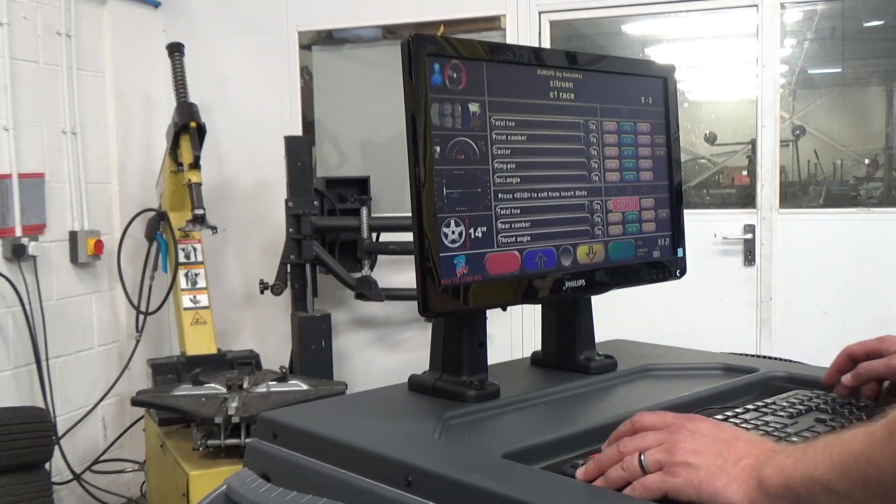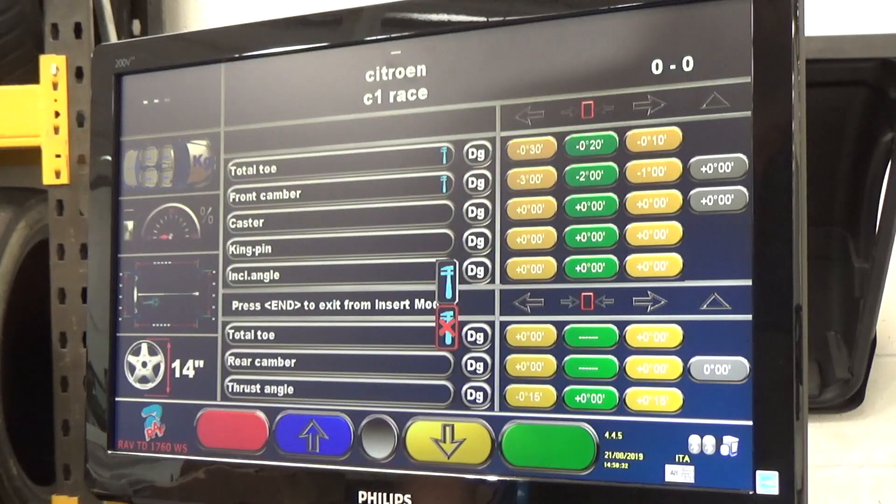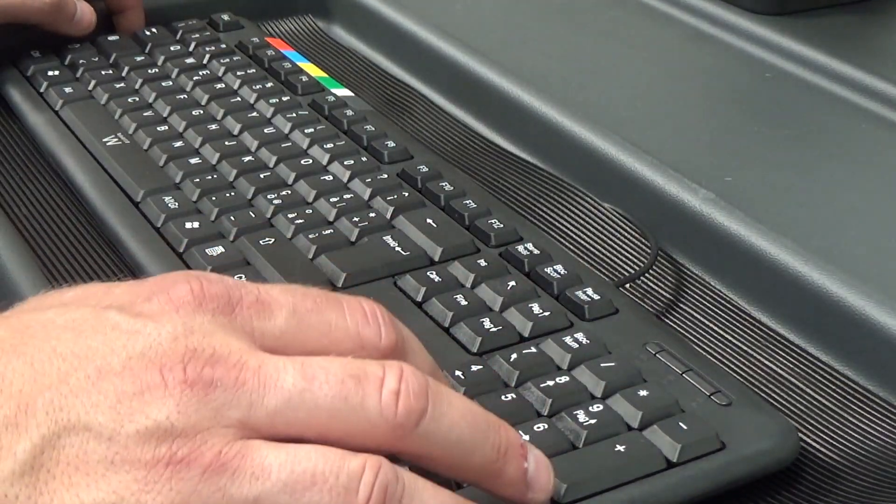You can go through the inclined angles, steering in and out — you can leave them blank most of the time. For rear toe, again select adjustable, and put in your middle tolerance value. For example, 0.010 degrees, with 0.000 as the tolerance one side and 0.020 on the other side.